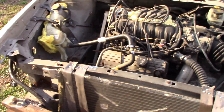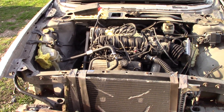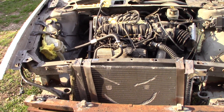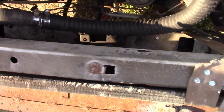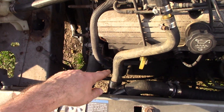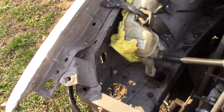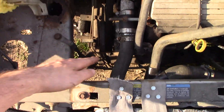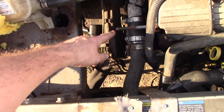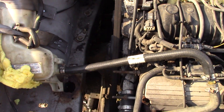The class this car is running in is a very stock show — more stock than most shows I run — so I'm guessing it won't be a terribly long show like a half-hour event. We've got the hoses looped. I ran them down here and even put in a Y-branch T-fitting, which looks a bit rough, but it's there so we can get the coolant reservoir in place to hold the fluid. I routed it up high so it goes up over my belt — I didn't want it running down low up front where it could get cut into the belt or melt on the exhaust.